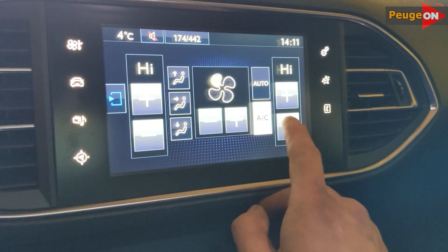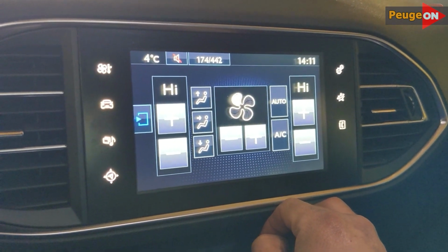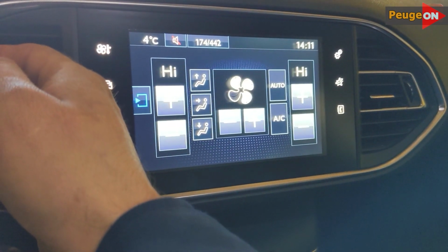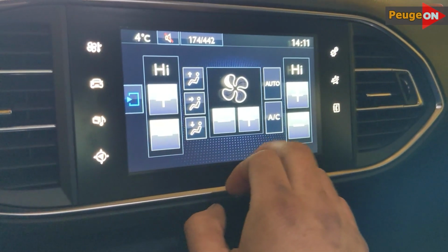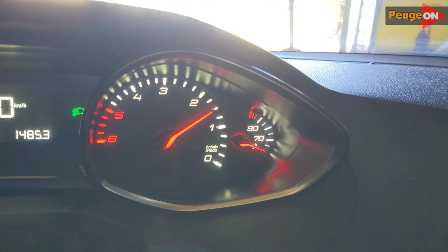In the cabin, switch the heater to manual mode, set the temperature to maximum and the fan to 1 notch. This is a somewhat debatable point. The thing is, the thermostat is very tricky, and personally, I haven't quite figured out exactly how it works, and I had a suspicion that if you don't set the temperature to maximum, antifreeze might flow through the heater. Well, with some weaker flow, and we need to flush the heater as well. That's why I said it this way.